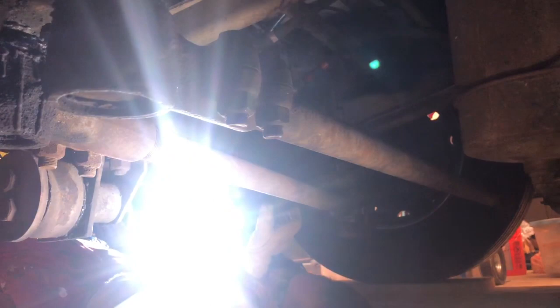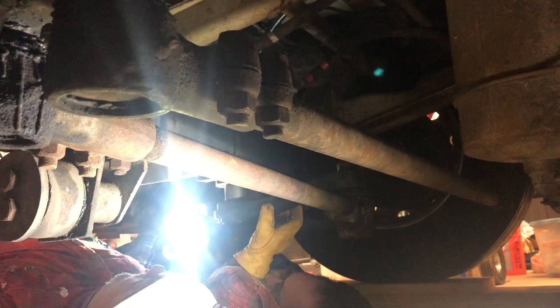Yes. Yeah, so I think let's undo this bolt, and let's turn your wheel. Turn it 90? Yeah, turn this 90, and then we're going to rehook it up, and we'll just reset your wheel. Do you have a leading spoke at the top? Or you have a three-spoke wheel, right? That whole thing lifts off there and can go back on however we want it to. I don't remember how they did it, but they did it at the alignment shop. They reset it. Let's turn this 90 degrees.